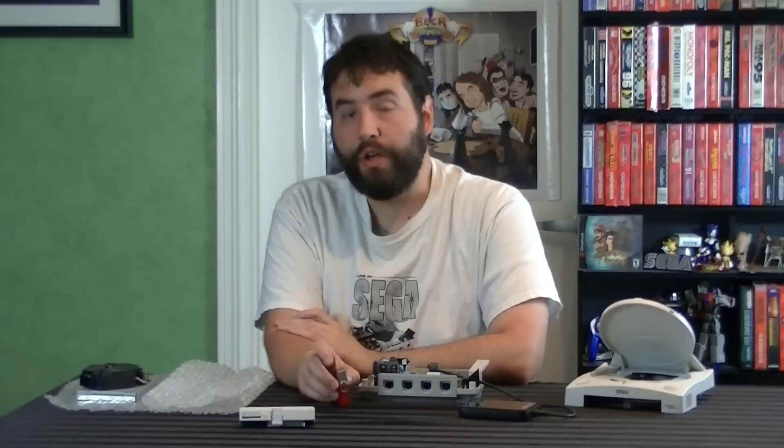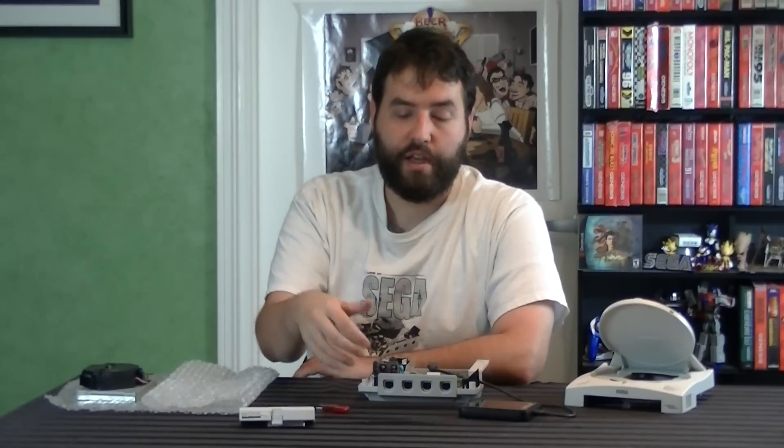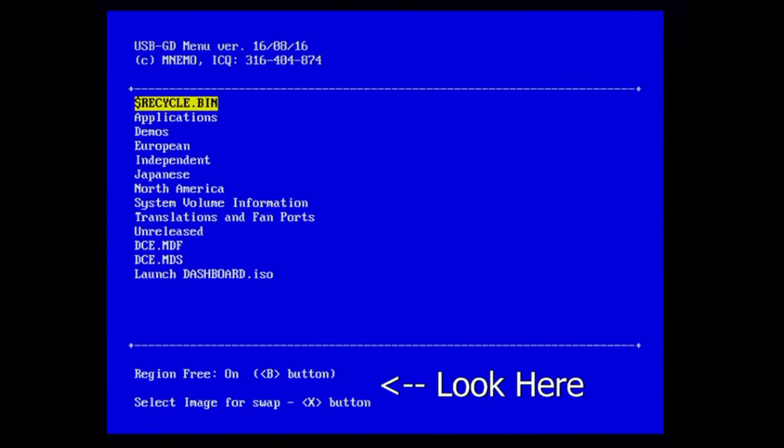One of the things that's great about the menu system is that it's region free. That was one of the big disadvantages of the GDMU — the device did not disable region coding. So if you put it into a North American Dreamcast and you tried to put a Japanese or European game in that first folder, the Dreamcast isn't going to do anything with it. You would have to do it as if it was a real disc — you'd put Codebreaker or GameShark in the first folder, preferably Codebreaker, and then the second folder would be the PAL or Japanese game. It would run Codebreaker, then you would press the button to switch at the right time, and it would switch to the second disc — the import disc — and then the Dreamcast can run it. With this, you don't have to do that because it just disables region coding, which is fantastic.